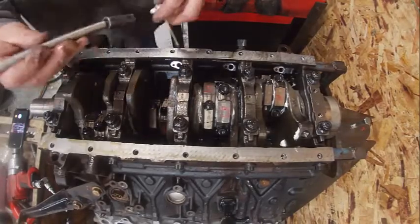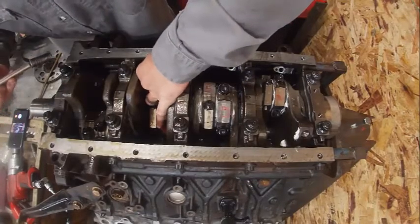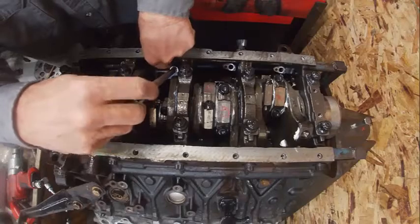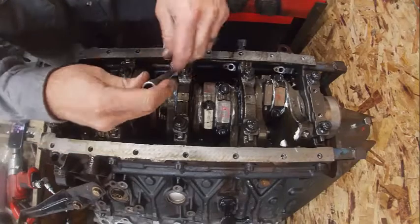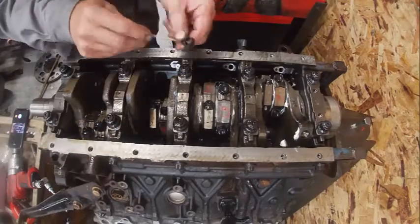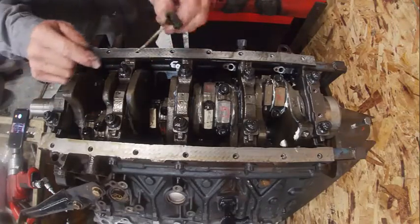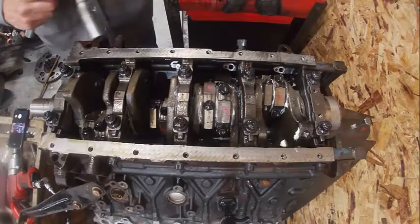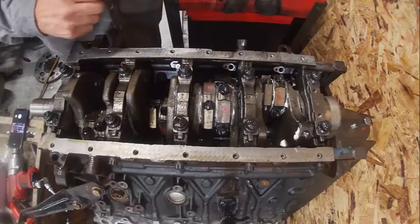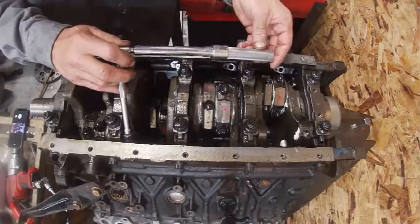A lot of times an extension and a socket will help you get them in there. The crank weight is a little bit in the way, so pay special attention when you're putting it in. Move it back and forth and make sure the locating dowel is in the right spot — right here there's a locating dowel and a hole right next to where it goes in. That sets it. Torque is 15 foot-pounds; I converted that to 180 inch-pounds because my torque wrench only goes down to 10.